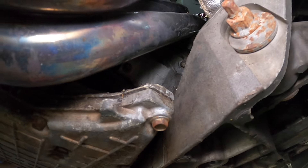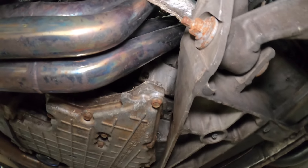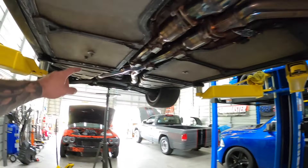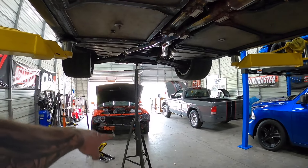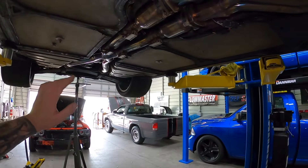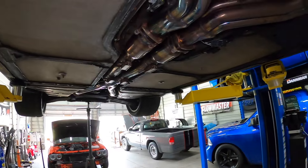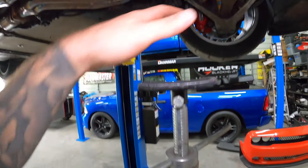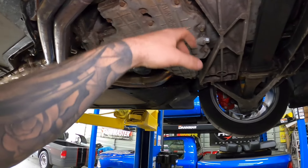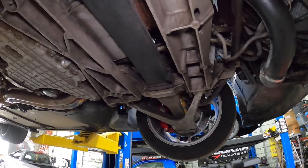It's going to be fun — not much room especially with these headers. If you guys are going to do this, I've got the rear supported with a support stand because the car is 50/50 weight. I don't want to be relieving the weight of the engine from the front while it's on the hoist — that would not be a good time. Got one stand to relieve the engine weight and another to support it.